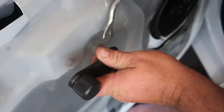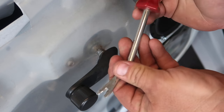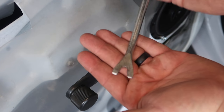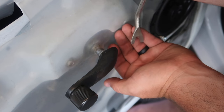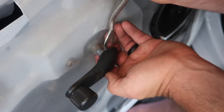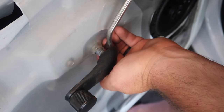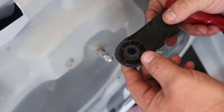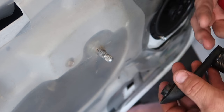Basically what you're going to do is take a flathead screwdriver — or in this case what's called a crow's foot, which is actually a door panel removal tool that gets in there and wedges behind door panels. We're going to take that into the clip itself. Always want to put your hand below where you're working because these little clips tend to fly off — and that one just did, it's on the ground. But there's my window crank. You're going to have to do that before you remove your door panel, so just note these don't slide on and off that easily.